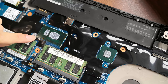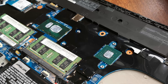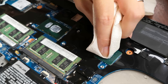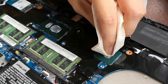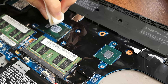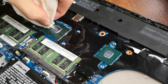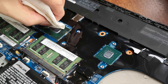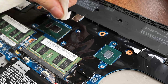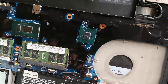Since we'll be applying new thermal paste, we'll have to clean this up with alcohol solution as well. Before doing anything else, wipe off whatever you can with the dry lint-free towel. This is fairly new, so there's not much caked-up thermal paste right now. Do the same for the CPU. Wiping with a dry paper towel actually got us more than halfway there.